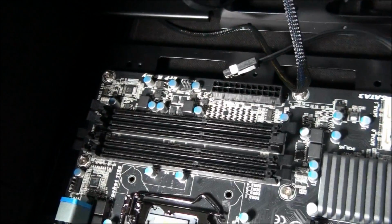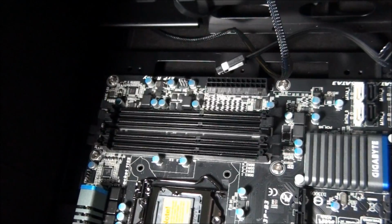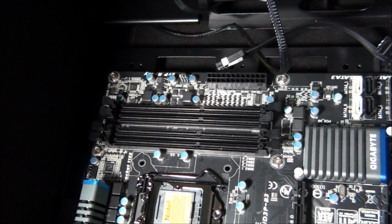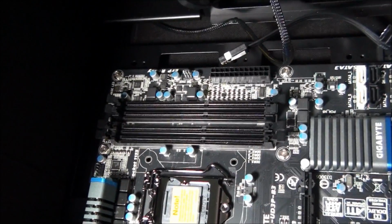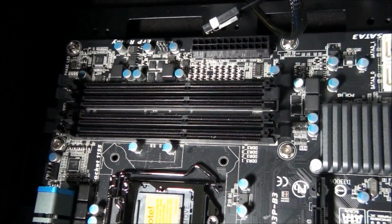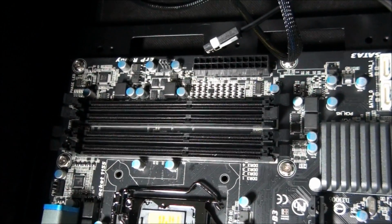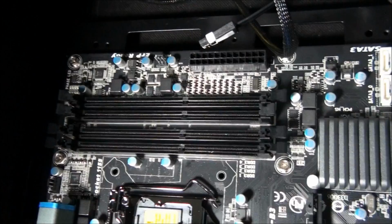It depends how many channels of memory you got. Some motherboards will be single channel, dual channel, triple channel, and now we've even got quad channel. So they're often color coded, the positions that you need to install them in, but basically I'll just show you, because these ones aren't color coded, which makes it a little bit more difficult, because it's not often that they're not color coded.